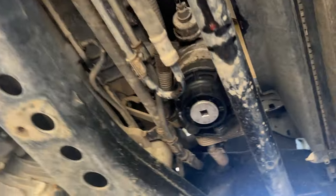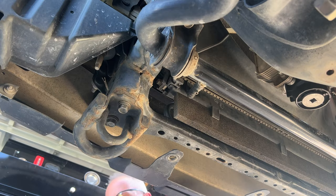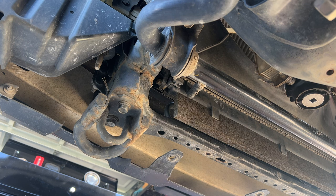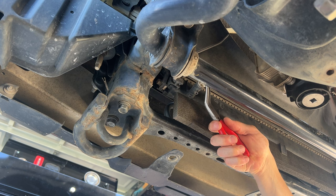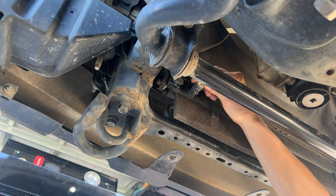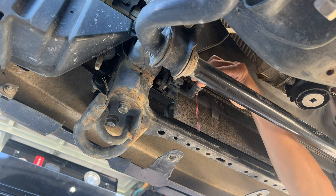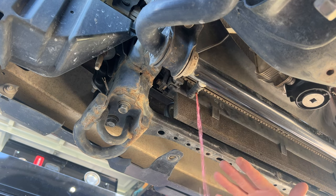From here you have access to the radiator drain, which is right there, right next to the oil filter — you've been changing the oil for the last 100,000 miles. Got a bucket. Just putting it right down there. I'm going to use these pliers to grab onto that petcock and twist it. Be careful — it's just plastic, so it's easier to use this than my fingers. I'm just going to go until it starts flowing out the bottom and let it go for a while.